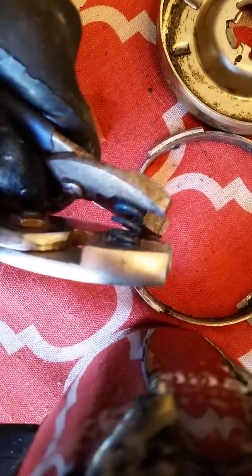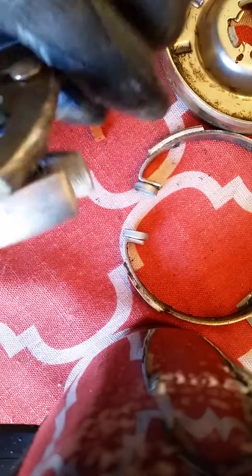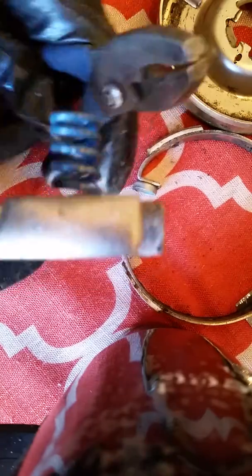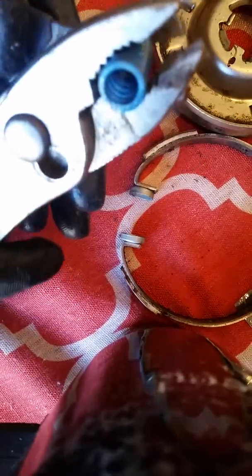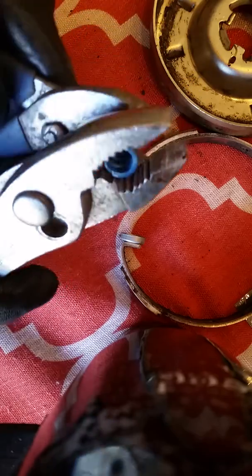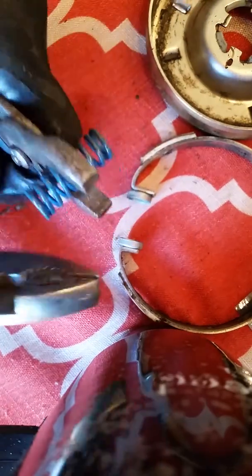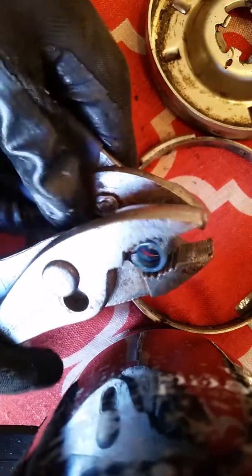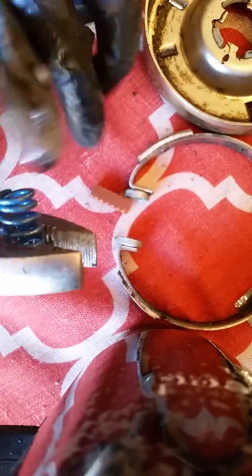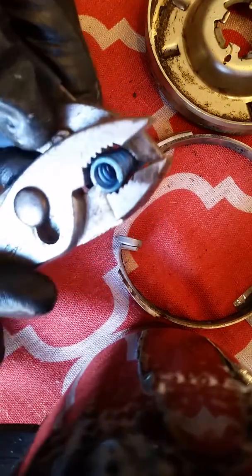Stretch the middle — this stretch is great for you do-it-yourselfers. By re-stretching this spring it will take years for this to malfunction again. I'm actually stretching it further than the manufacturer's specs. A better method: if you have a vise, you can just clamp this thing and get it nice and stretched out.